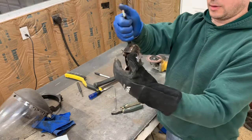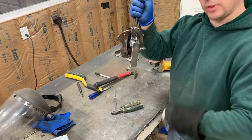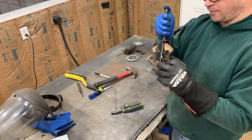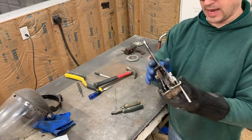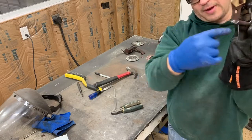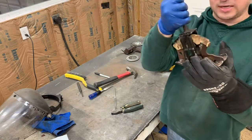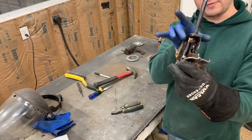As it stands right now, it works. And I have a lower arm, so I can attach my cable line to the bottom down here using the ball we were talking about. But the concern I have right now is I'm probably going to have to cut this off right here. Again, my mounting points are probably going to be here and back here. I'll probably do a piece of plate with a 90-degree bend on front and back, and then that'll weld to the plate for the actual stock shifter. So then that'll set this into place. And it'll function. But my concern is, do I have enough? Is this in far enough to clear? I don't think it is.